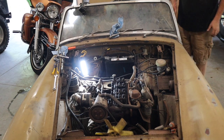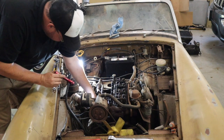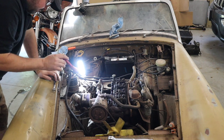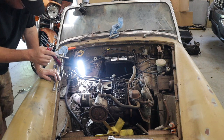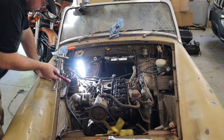Alright, that's both of those valves up. That booger is 180 out — that's exactly what's wrong with it. It's 180 degrees out. This intake valve just closed, which means we are on the compression stroke, piston's all the way at the top, and dang if that rotor button isn't pointing straight exactly opposite of that number one piston. That sounds to me like somebody done put it in backwards.